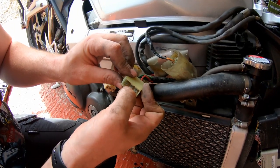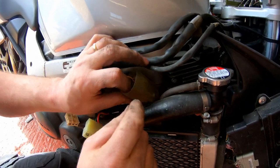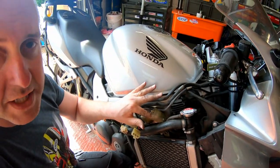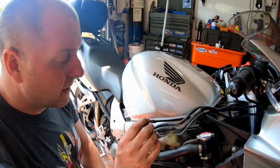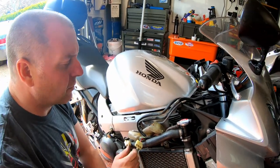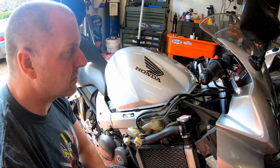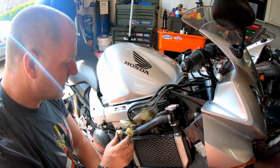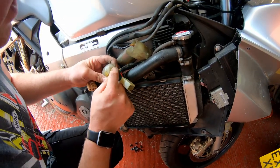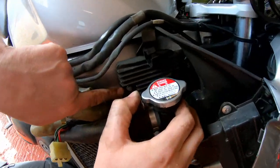Right, got it apart. Yeah, a little bit of corrosion in there - those pins aren't as clean as they could be. What I'm going to be doing is cleaning up this connector and covering it to weatherproof it so that water can't get in, because we're not going to actually need to use this connector again once we've carried out the upgrade. I've got a little mod I want to add to this bike which will use this connector, but I'll reveal that in a future video. Let's get the reg/rec off the bike - there are a couple of little bolts here, little 8mm bolts.